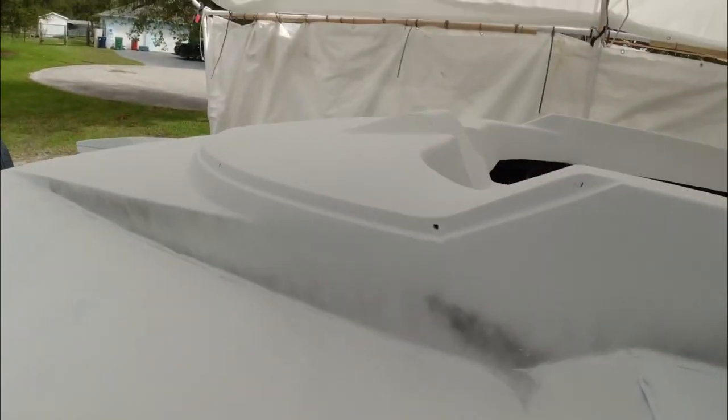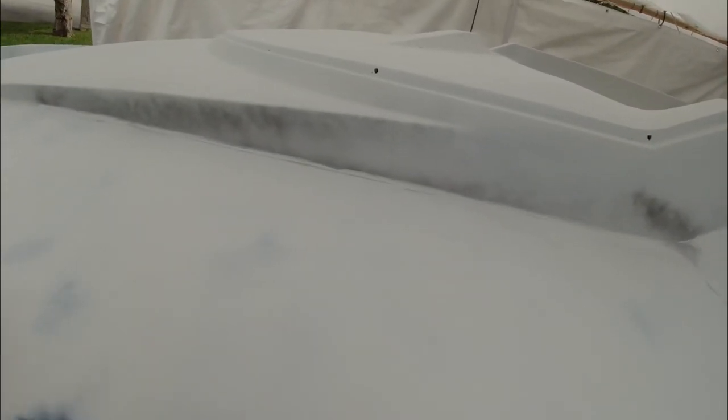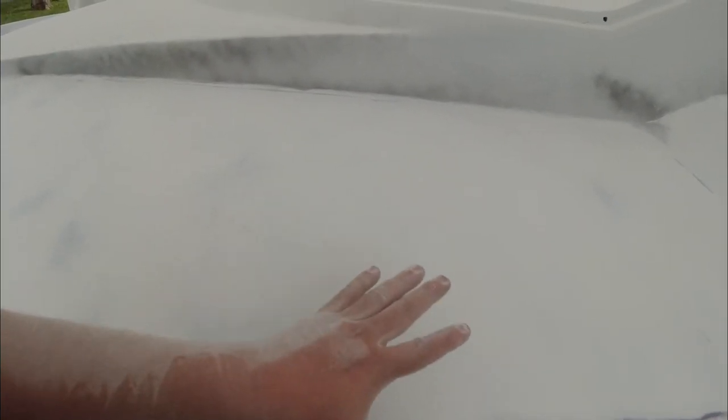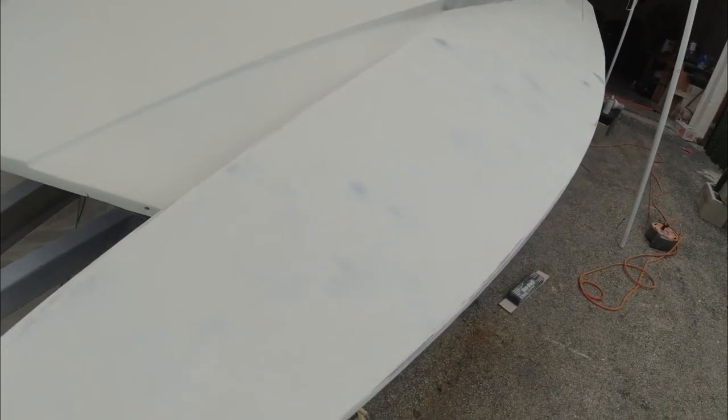But here's an update. The DA sander worked perfectly. I made sure to keep it down smooth and flat when I was sanding, and not to stay in one area for a long time. I also didn't rub certain areas more than I needed to. So the front is pretty much perfect. I am going to block it just for the fun of it, but this feels super smooth.